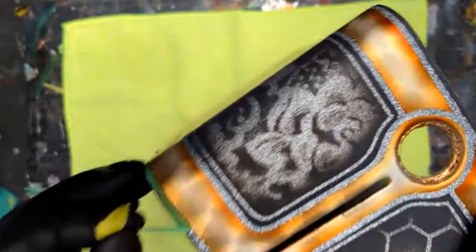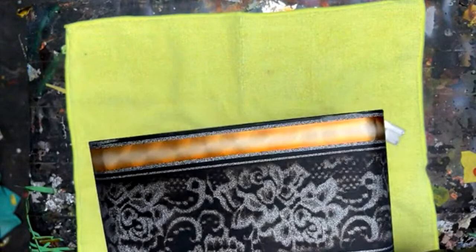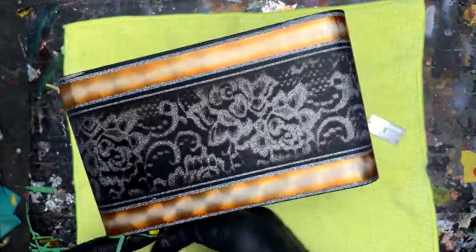Riel said, would you sand between every 3 coats or each coat of clear? No, you can do the coats consecutively. You just wait for the dry times between coats, depending on the temperature and what you're spraying. Usually 10 to 15 minutes between coats. Once you max out at about 4 coats, you get so much clear on there that it's hard to layer more, because it's getting so thick.